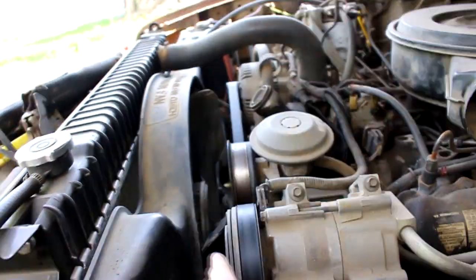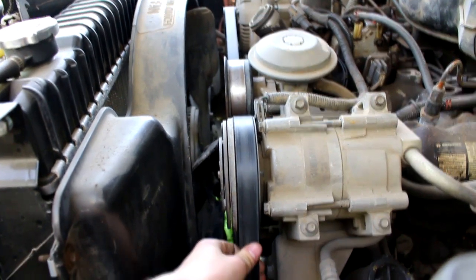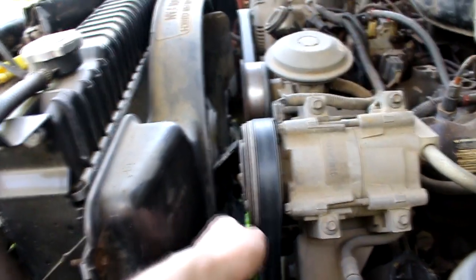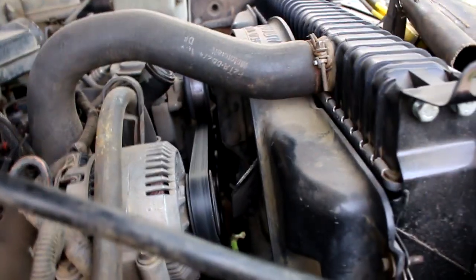I decided to take the camera around so we can look and see what's going on — see if we have fire anywhere. The problem is, I'll explain why the belt squeals. The temporary belt tensioner that holds the belt tight is not springing back, so it's loose. And I think this is the wrong size belt too — it's not the right belt. Another thing is the water pump's out. This is the reason why I don't want to drive it, because the fan's going to go through the radiator. That whole thing is pretty gone. The water pump is shot — that's why I don't want to run it too long, because that fan's going to go right into the radiator. I've had that happen.